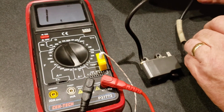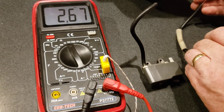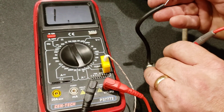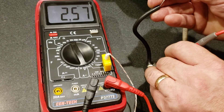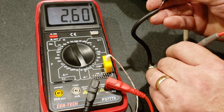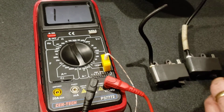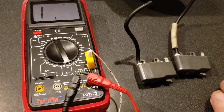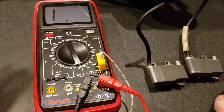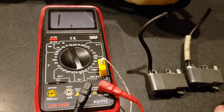The resistance on the new one is measuring about 2.67 kilohms. The resistance on the older one that's not sparking too well also measures pretty close in that approximate range — 2.57 kilohms. So not a lot of measurable difference, but there's a noticeably large spark difference on the new one versus the old one. That's what I wanted to let you guys know about — how to measure the coils. Thank you.